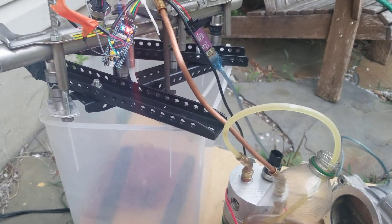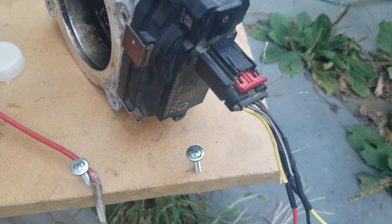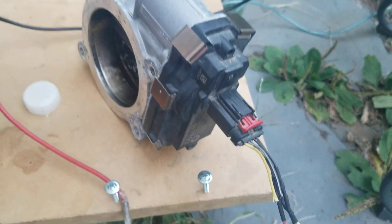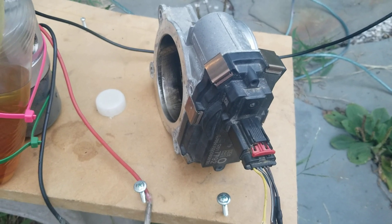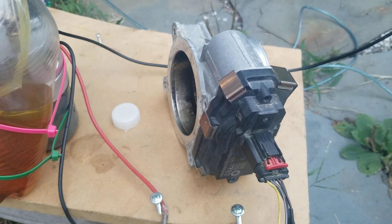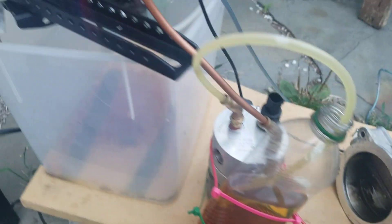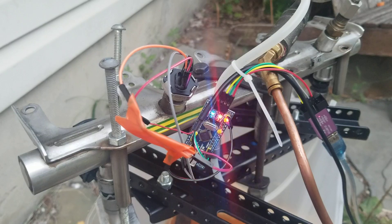Overall these are steps for the GDI project. GM uses these five-wire throttle bodies these days — five wires, not six, because only one wire carries the composite digital position signal. In order to get the throttle body to function, our first success is with the pressure sensor, which is also digital.